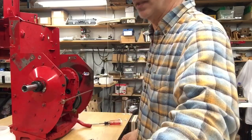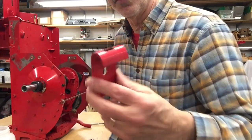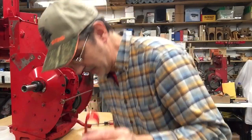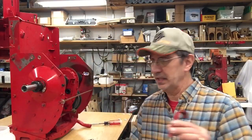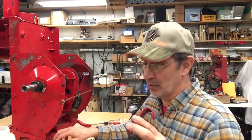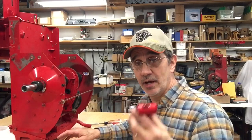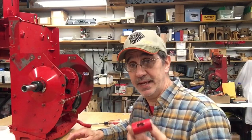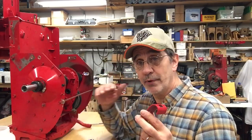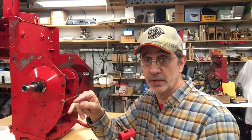Let's get started tearing this apart. I already took off the bracket for the bagger. A lot of you guys know what these are, most of you have them. This is typically on the right-hand side of your machine—it's a brace that goes around the rear bumper, and that helps the bumper support the weight of the bagger. Because a lot of them without this, the bumper will break right where that screw goes through that holds it on the back of the rear case.